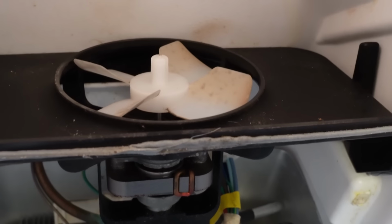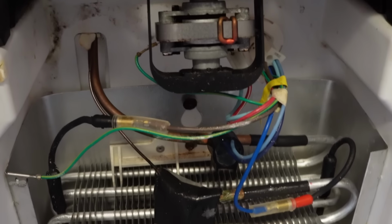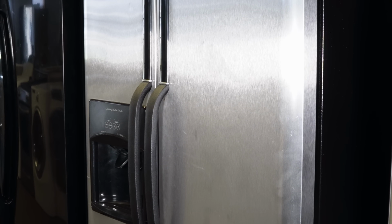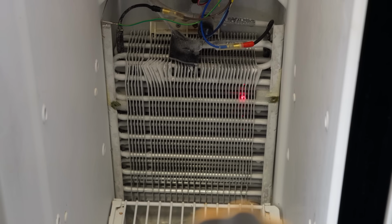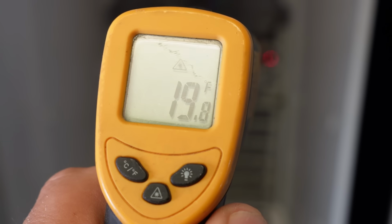Now in the case of this exact specific refrigerator we've been messing with, I want to make sure it's operating right, and I don't like how the coils are totally unfrosted. So I want to close the doors and leave it running until the next day to see if we can find a frost pattern on this refrigerator. I think it just defrosted prior to making this specific video. The next day you can see clearly that frost is on the evaporator system and it's cooling decently, but it's not working the way I want to yet.